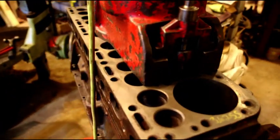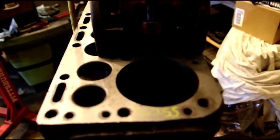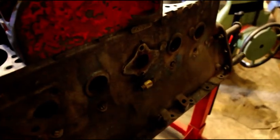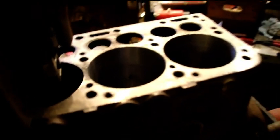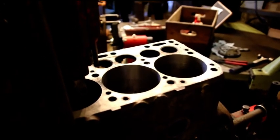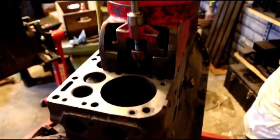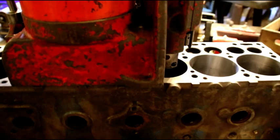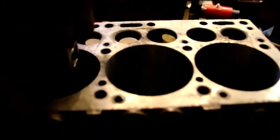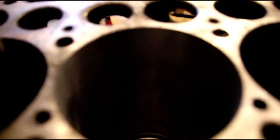The forums say sleeves are better than the original cast iron block, and if I hear the word 'forum' one more time I'm going to go crazy. You never seem to get accurate information from forums - that's been my experience. I've been asked to leave lots of forums because they don't want professionals, only backyard mechanics. Don't take a good cylinder and sleeve it just for the benefit of thinking you have slightly better cast iron and put holes in your block - it just doesn't make any sense.